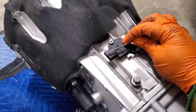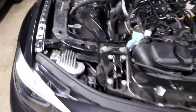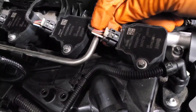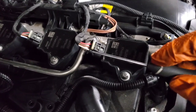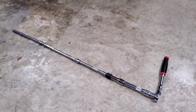I felt around until I got my pick between the connector and the tab to push it out, then used my finger to push the connector off. These connectors have to be unclipped — you push it and it pops the connector out, then push down on the tab to release it. When you push it back in it'll snap in place. If you get your pick in between and feel it wedge in, then just push until that tab pops out.